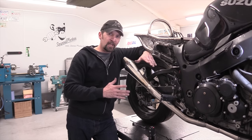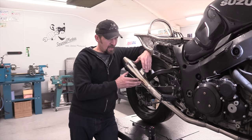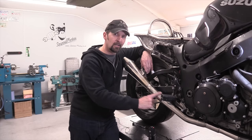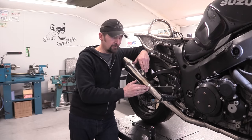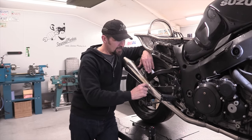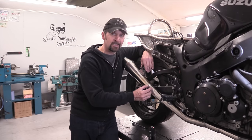Right, there we go, day 58, a really nice result for that, a permanently welded in exhaust reducer. And that joint means I can slip my can on and it's exactly the same diameter as the link pipe, not that usual step that you get with slip on cans. This is a far nicer looking result. It also means that with a slightly wider clamp that I've ordered, I can cover the slots that allow this can to clamp on, and at the same time it will cover the joint itself.